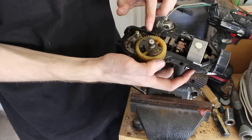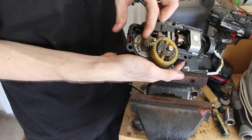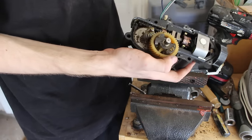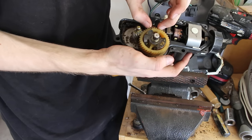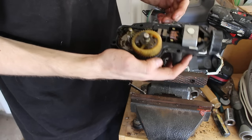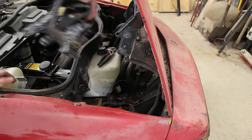There are supposed to be rubber bump stops inside the gear — two here and two there — but they're not there at all. What's there is just disintegrated debris. Typically with Fiero headlight motors, this gear shreds and deteriorates, but I'm glad that it's fully intact. That motor I just showed was completely rebuilt off-camera so I could look like I knew what I was doing when I show you how I rebuilt this one. With the second one apart as well, you can see it was the exact same story.